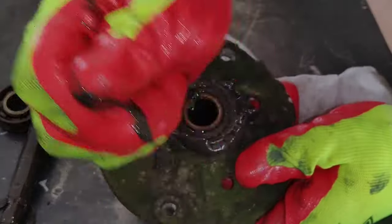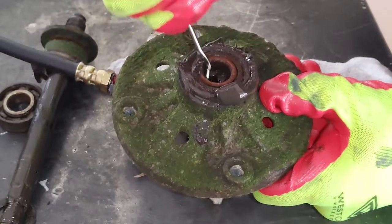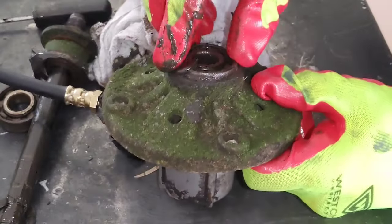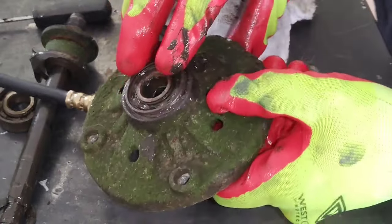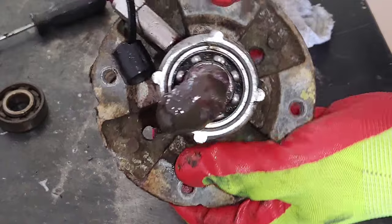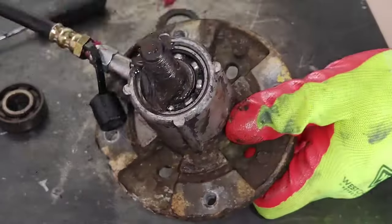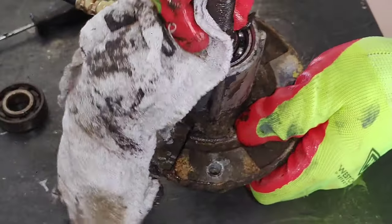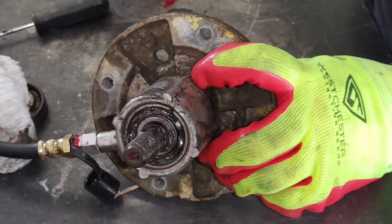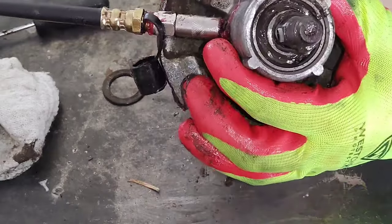I mean, in my opinion, just having this, never greasing this, and just assuming that small amount of grease that comes into these bearings from the factory is going to be sufficient for the life of these spindles, I find that to be a little naive, honestly. Looks like this bearing's actually been pushed out a little bit, but even though it has that seal in there, I don't know if you guys can see it, but it's just pushing grease. It's going to get into those bearings.